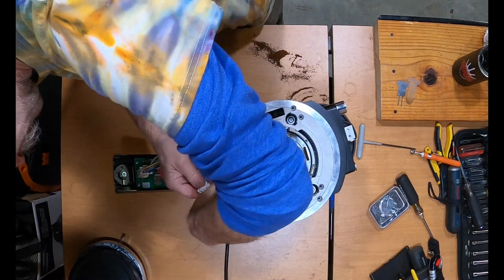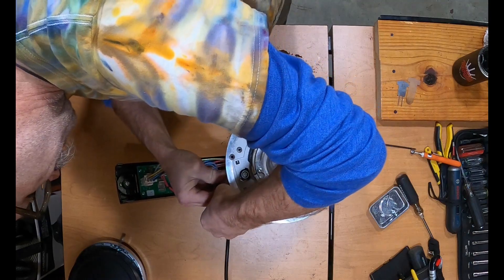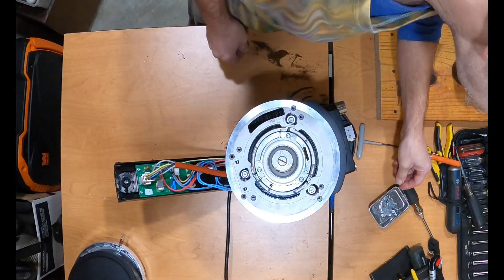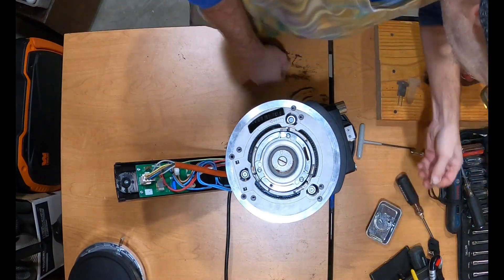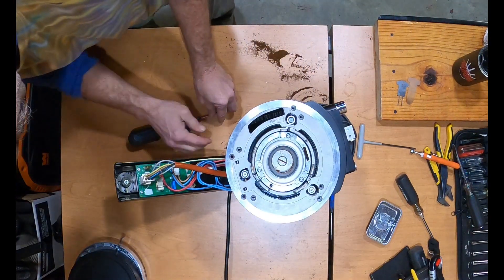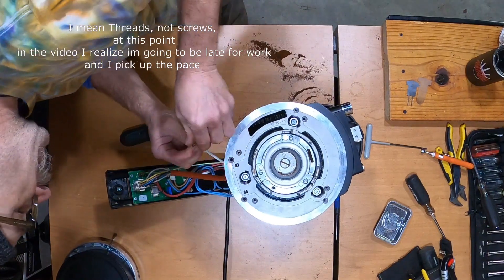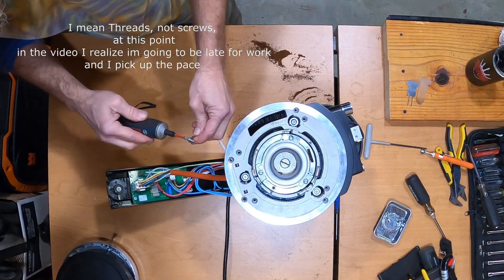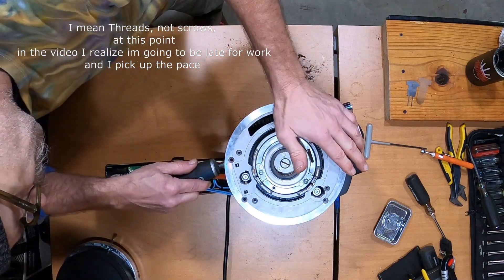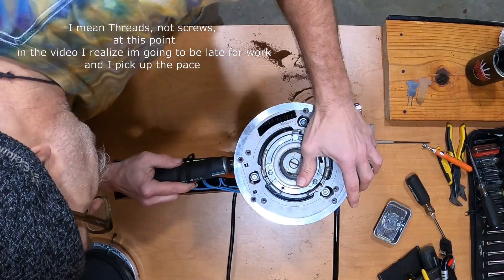Plug up the power board, then plug up the hopper safety. Then find the somewhat special screw that holds the temperature and grounding rod piece that we ran down to the bottom — fish it back up. There's a hole in the back of the motor; sometimes it will already have screws, sometimes it won't, and you just make your own threads.